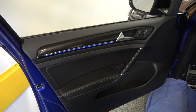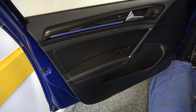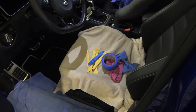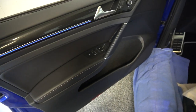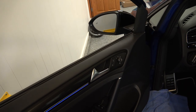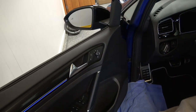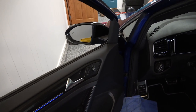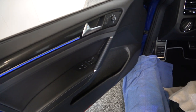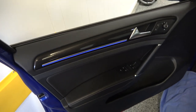The first thing we've got to do is get our door panel off to get access to the wiring and the bolts that hold the mirror onto the car. Before you start, do yourself a favor and put some towels down to protect your door sill, seat, and leather. There'll be tools flying around and things moving. We're going to do the same when we get to the mirror removal - on the outside we'll tape a little blanket on the side of the door to protect it. Take the extra two minutes to put down protective coverings on everything.